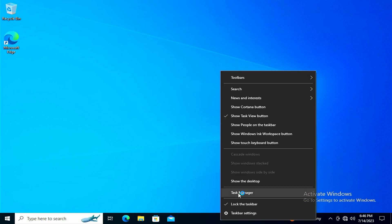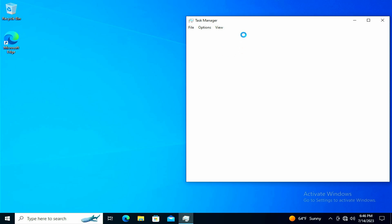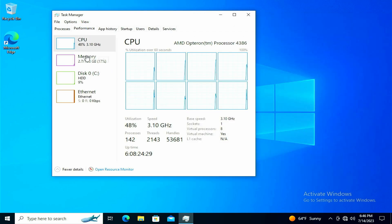One other cool thing this older system does extremely well is GPU passthrough. It's super painless. I just enable AMD IOMMU in the system, pass through the GPU to a VM, and as you can see right here, it's passed through. This VM is running on the system with keyboards and mice passed through too - no issues, works just fine. It's not super fast because it's running on older slower hardware, but I was surprised there were no issues doing it, showing how server hardware was kind of designed for this workload a lot before similar consumer hardware was.